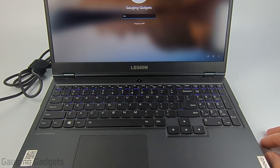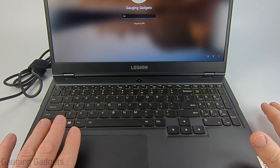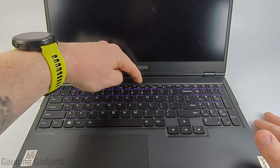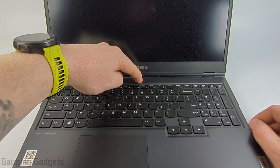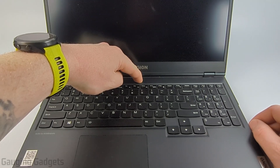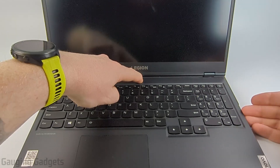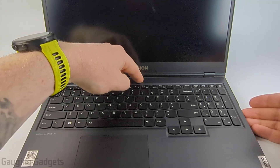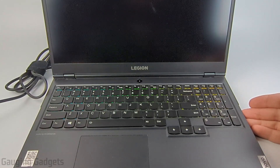If it did not, we should try a hard reset of our laptop — and don't worry, this won't delete any data or anything. All we need to do is hold down the power button right here until the laptop turns off, and usually that takes around 30 seconds. This will do a quick hard reset of your laptop, and then once you're done hit the power button one more time and it should turn on with no issues.